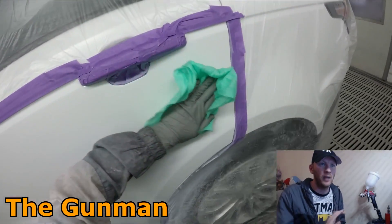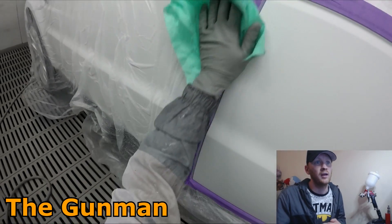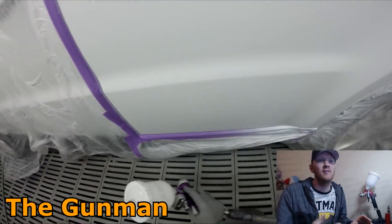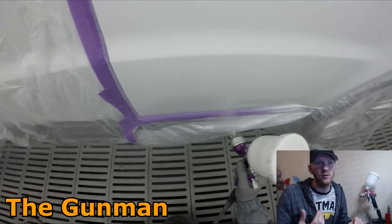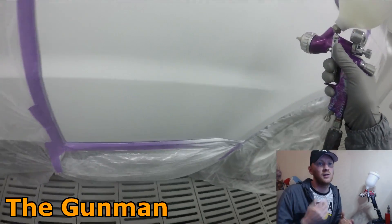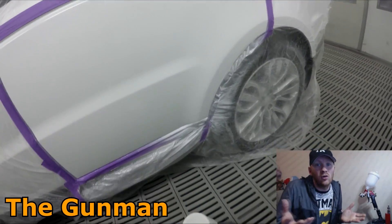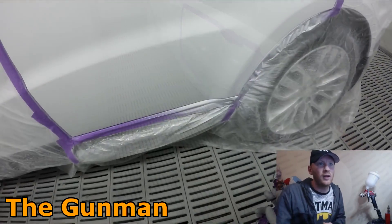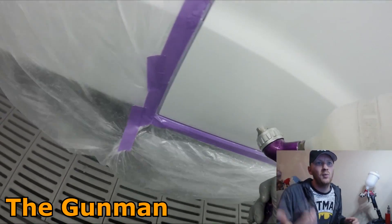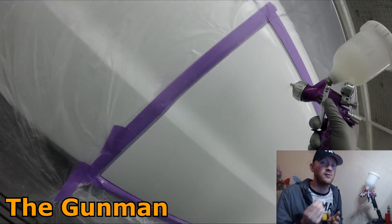It doesn't seem to happen with metallics for some reason, but with solid color whites you've got to be very careful blending them. It was only fairly recently that I figured out the best way: take your time with the blend, trigger at nice high pressure, and be careful not to get too much color over your blend area. Sometimes I'll even avoid blends altogether — if this car was say a white Toyota HiLux or commercial van, no way would I use clear over base on it. But the reason I used clear over base here is it enables me to blend, I don't have to worry about 100% color match, and the car itself was painted in clear over base from factory, so I like to keep them original.